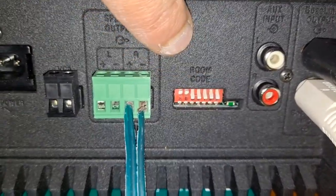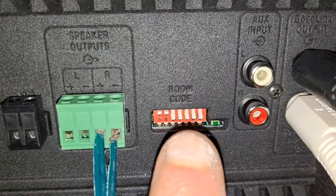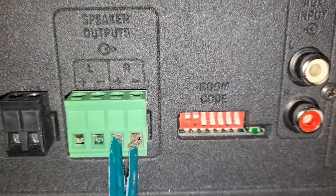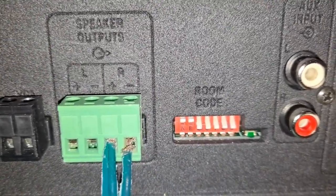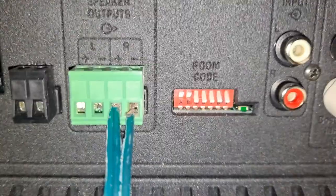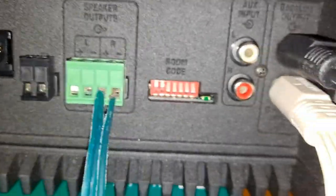Here we go — auxiliary inputs. And here we have a DIP switch. If you want to use the auxiliary, you're going to have to flip the switches. You can see a few switches there that you can turn down and up — one, two, three, four, five are down on the right, and the two on the left are up. The two on the left are for the auxiliary, and for stereo — you can use it for mono, but I personally use it for stereo.